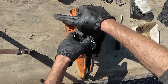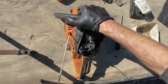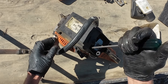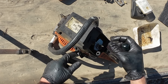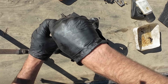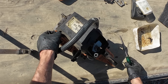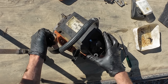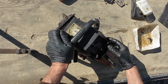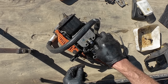Reasonable compression there. These cheap Chinese saws have pretty sloppy tolerances, so they're never really that great from the factory, unlike the Stihls and the Huskies. They do go all right when they are running. We'll see if it sparks first of all.